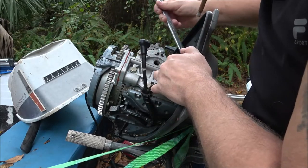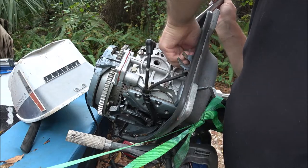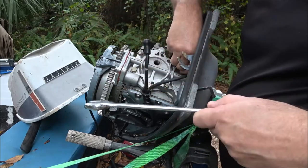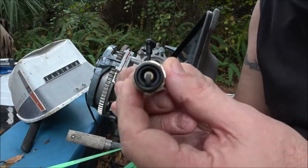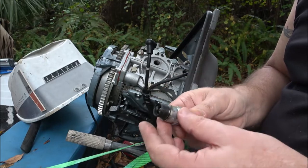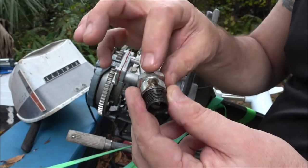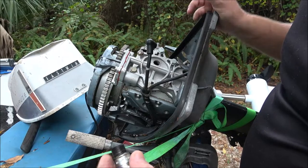This is the one I had to put that helicoil in, that repair kit. So hopefully it stays in and the plug comes out. No, and it didn't. But it doesn't look real bad either. It's got the same thing around there. It's been leaking right there, so these things don't seal up right. See that? That shouldn't be there. That's coming out, not dripping down, as you can see. That's actually coming out of the cylinder, so I'm definitely losing compression on this cylinder.